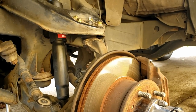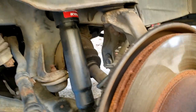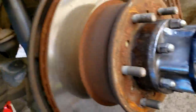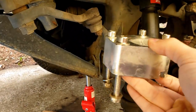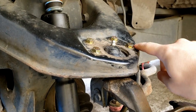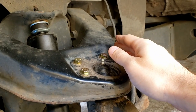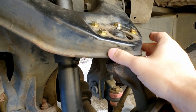Looking at the suspension in this pickup truck and what the previous owner had done: with your ball joint right here, they have this ball joint spacer, which fits right underneath the upper control arm. This ball joint spacer, if you actually measure it, is only an inch and a half — but it's advertised online as a two and a half inch lift. That's because once the ball joint spacer is under here, you're instructed to crank on this torsion bar, which is connected to the upper control arm, and this gives you an additional inch of lift — about 12 turns, give or take.